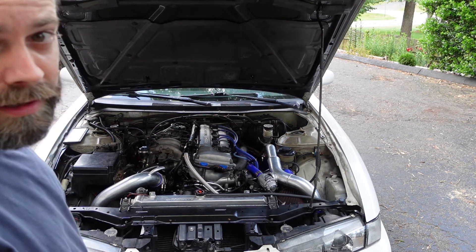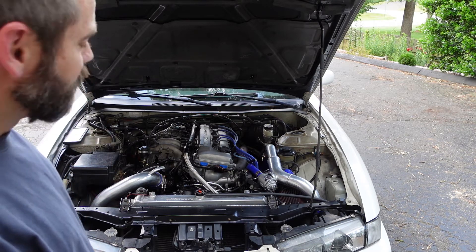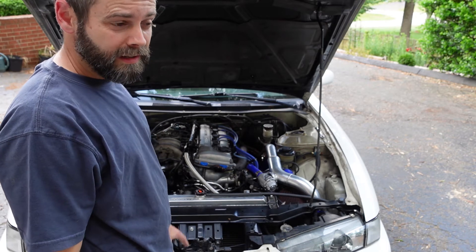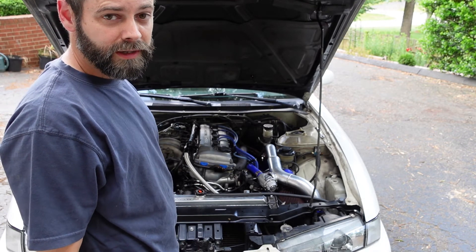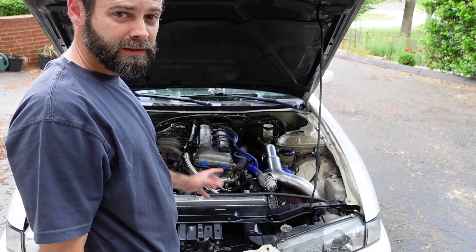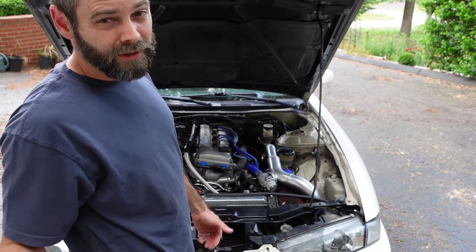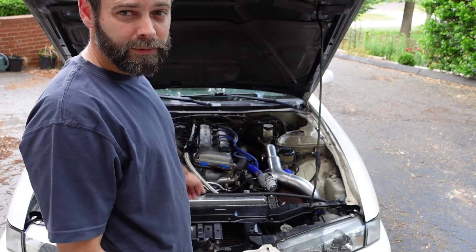She doesn't seem to like it when I plug back in the throttle position sensor — that's the problem we've been fighting with. But the idle is set back to 750, and base timing is set back to 20 degrees before top dead center, so that stuff's right. This is kind of the issue we were chasing before the engine failure. I checked all the voltages on everything before we took the engine apart and everything was in order, but apparently something still isn't right. I'm going to pull it inside to do the stop switch and throttle position sensor reset — if it thinks the throttle is opened or too far closed, it'll do that chasing idle. It was running perfectly smooth with those sensors disconnected, so there's probably something in the setting of that sensor.